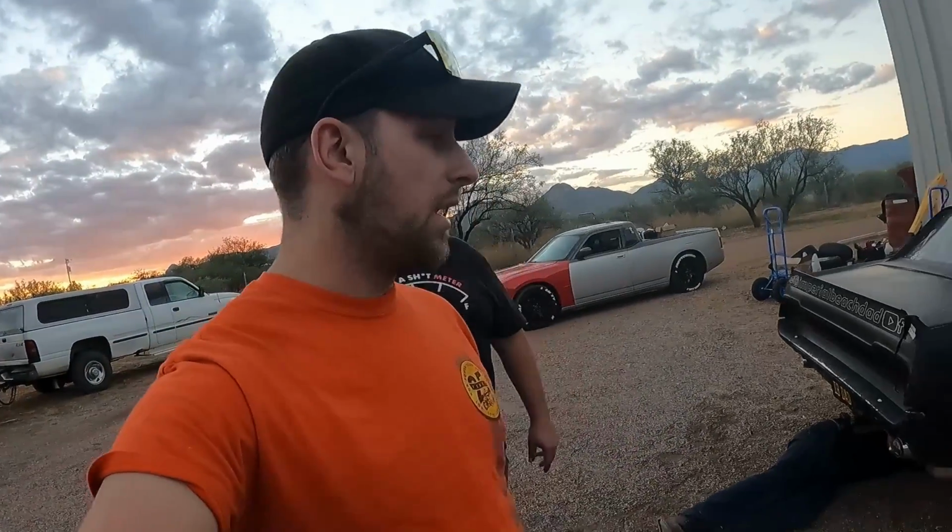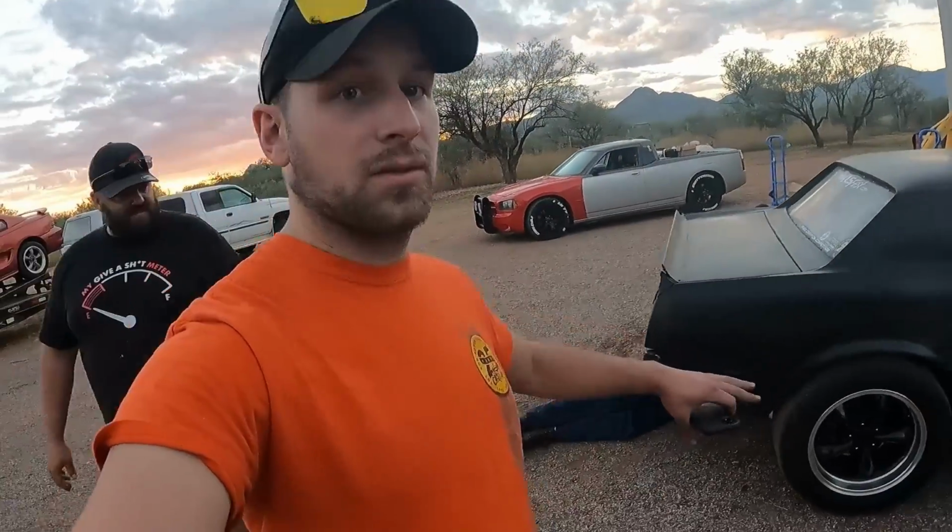Just because of the mad thrash, come to find out with this 4-link being so short, the driveshaft actually pulls out of the transmission too far at full ride height. So I guess the springs were not fully compressed, or it was a little closer to full droop than it should have been, and engagement is not bueno.